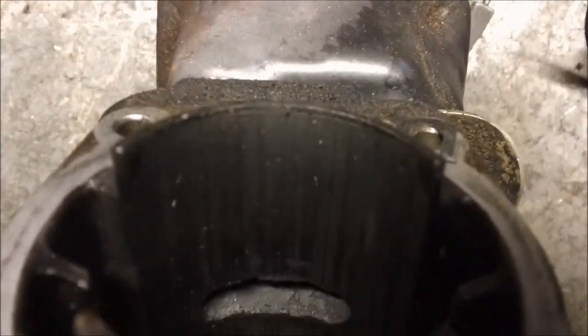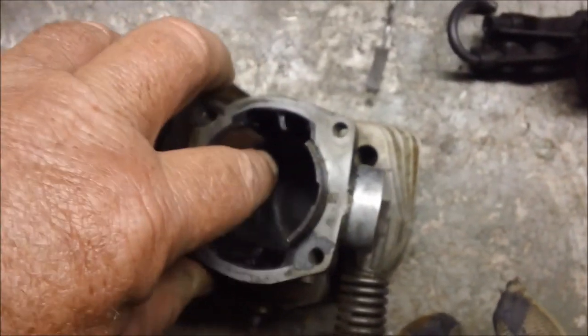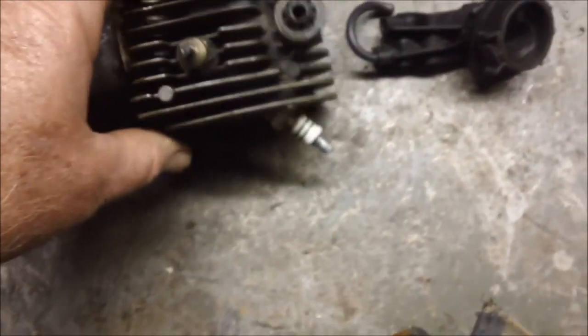And looking in on the exhaust side of the cylinder confirms that the chances of that having a seal are pretty low. Couple of other observations is there's a lot of carbon in that exhaust port, so that cylinder needs some help. It's more aluminum transfer from the piston than actual scoring, so I think it's salvageable if that's a route that makes sense.